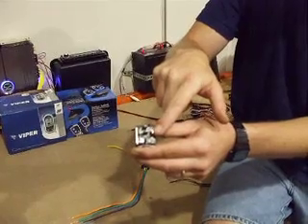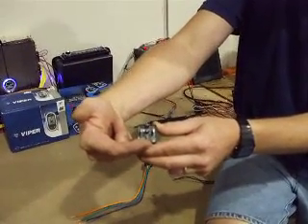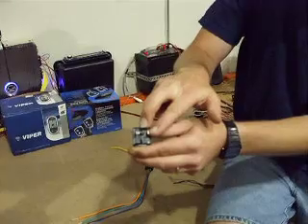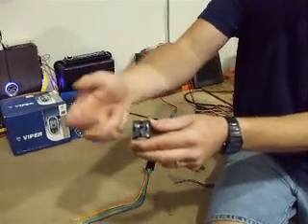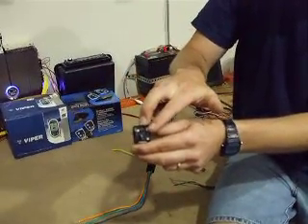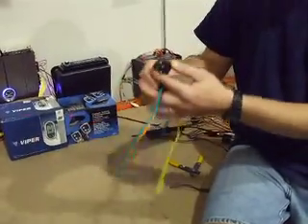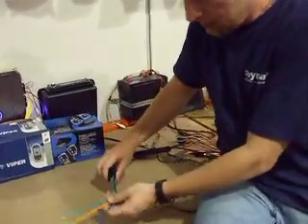Over here we're also going to put the same constant 12 volts, and it's going to come out here on pin 30 as 12 volts positive. So it's going to be negative going in. You're going to have your supply power of 12 volts constant on pin 87 and 86, and pin 30 is going to be your output. So negative in, constant on 86 and 87, and your positive coming out on 30. I'm going to take that relay socket, plug that right in, and lay it right here.